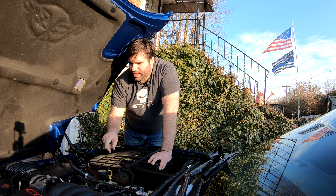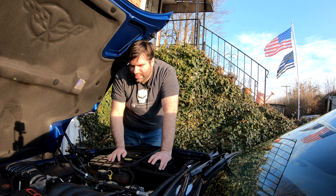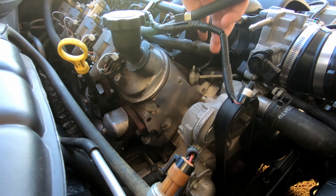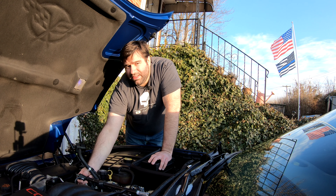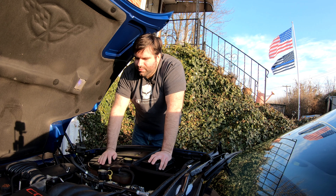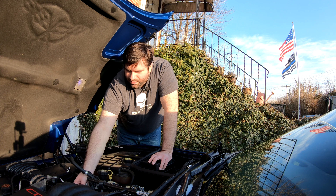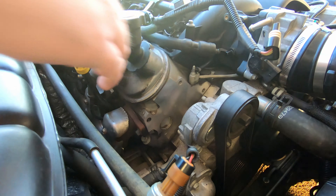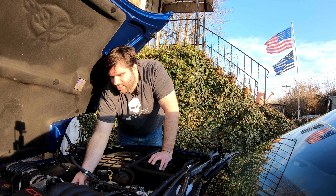Now with those out I'm going to quickly cover the three styles you're going to find on the C5 Corvette. If you have a Z06, you don't have the PCV line that runs all the way around the block — it goes directly down into the block with the PCV in that line, going down from the throttle body into the block. If you're running a 2004 LS1, there isn't even a PCV valve on the outside; it's actually within the block, so you won't have to worry about that. You literally just have a tube that runs from the throttle body into the block.